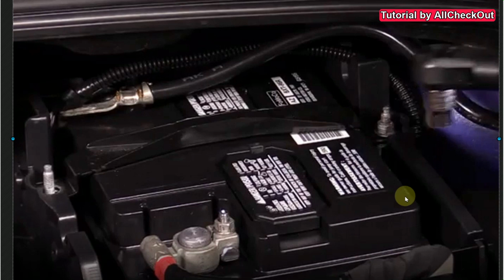It's just like an electronic reset, of course, of the automatic shifting. So the shifting has to learn from scratch how you are driving, but it's absolutely no problem. You probably won't even feel a difference, and after some time it will be exactly the same. So don't have to be worried about the reprogramming. Also don't be worried about removing anything else, so you really don't have to do that.